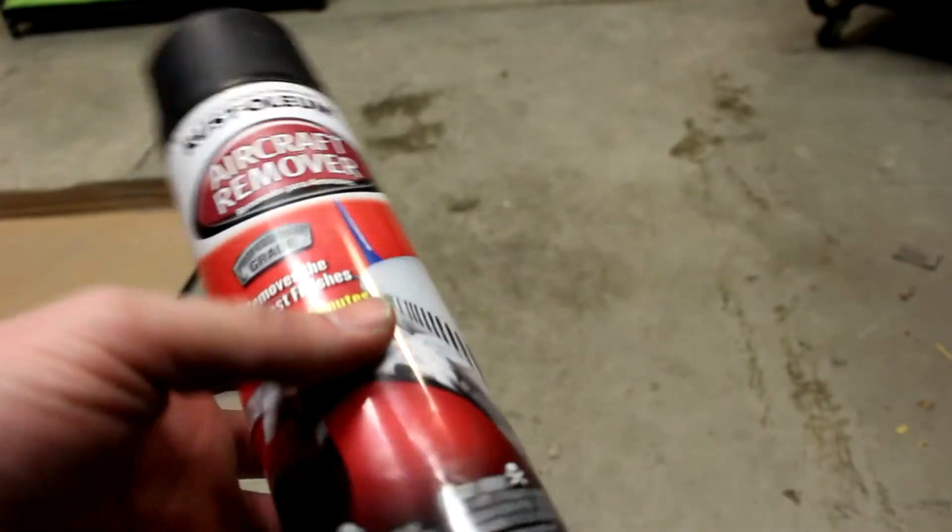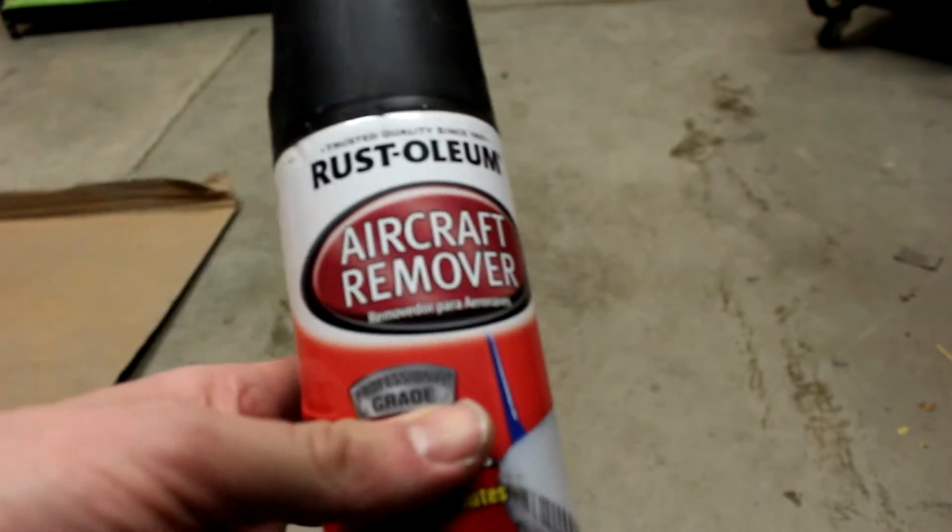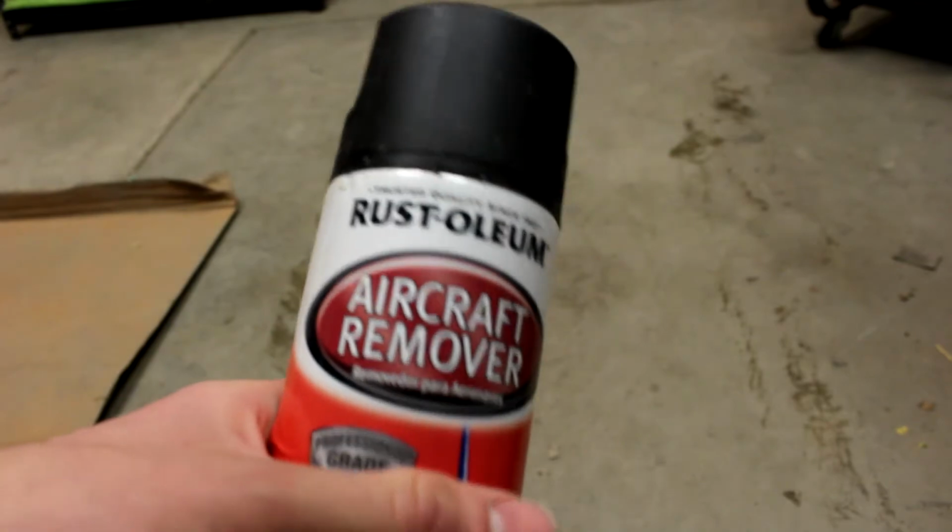the gray powder we put over top of it baked at a hotter temperature, and what I think it did was actually wrinkle the actual red powder underneath it, and that wrinkled the top coat obviously, and it just created a huge mess. So now it's Saturday. I should have had this job done like Wednesday or Thursday, and we're still screwing around with them, stripping them off one more time. I've talked to the customer. We're gonna completely negate the two-tone thing. We're just gonna hit it with the silver color, and that's it.